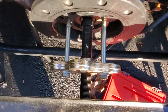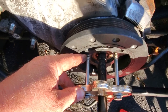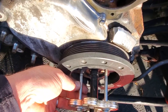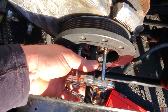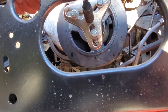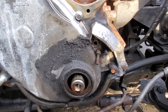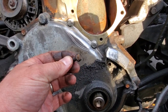With the puller assembled, make sure you have good thread engagement. If you start cranking and these aren't threaded all the way in, you'll strip the first couple threads. But also don't go too deep - if you bottom them out you will puncture the timing chain case. Get them in nice and snug and even, so when you put pressure on the center pin they pull out evenly. We did it - here is your timing chain cover. I can already see an issue: a bolt worked its way out and is missing.